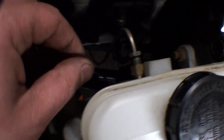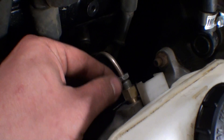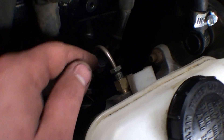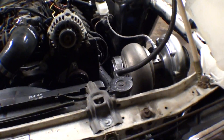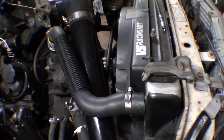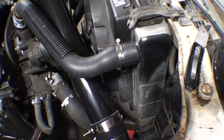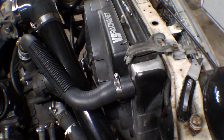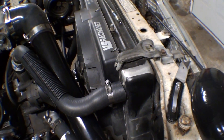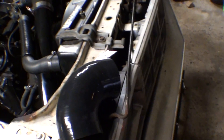This metric fitting fits in here and then there's a metric adapter on the back — it's actually bigger. I go to thread it in and it cross-threaded. I spent two hours on it the other day and got nowhere. Just today I put the water neck on, got the hoses on, topped off the coolant, and fired it. It's a two-speed fan and on low it hits at 200°F, immediately knocks the temp down to 190, and shuts off beautifully.